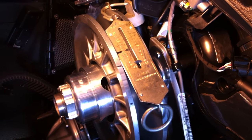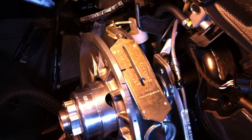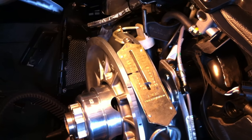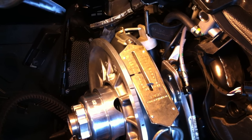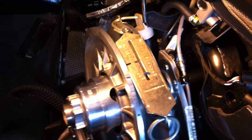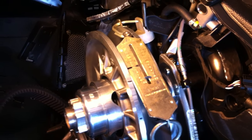So if you're messing with a Dalton and you can't get it within 5 pounds of where you want to be, just turn it around 180 degrees. And those two holes on the opposite side will fall on either side of your current measurement. So you should be able to easily get to approximately every 4 to 5 pounds on a Dalton helix.